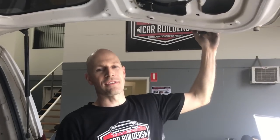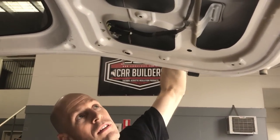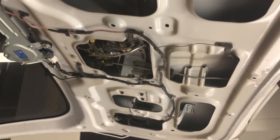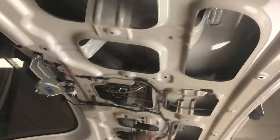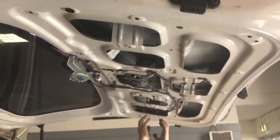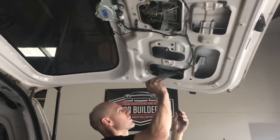So we'll remove the cover on our tailgate, and as you can see here, we'll tap on the outside. It's really drummy, so you are going to get noise that bellows up from the back of the car. You are limited in getting to these panels because there are little openings. So what we'll do is cut up some tiles and feed them in there and place them around and just keep tapping on it until we're satisfied that the sound's gone.